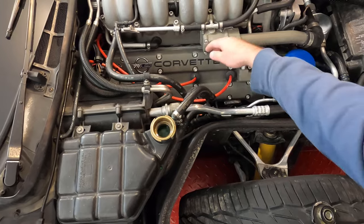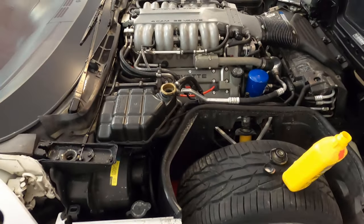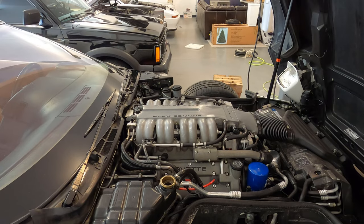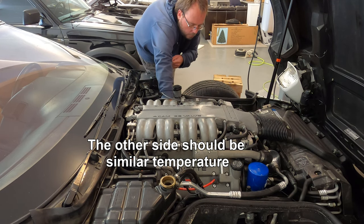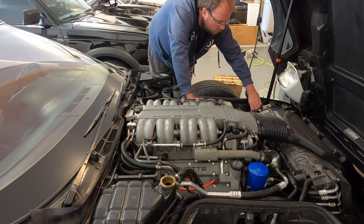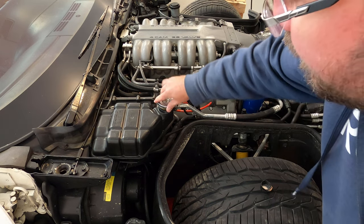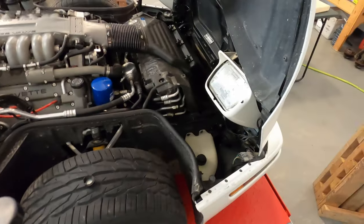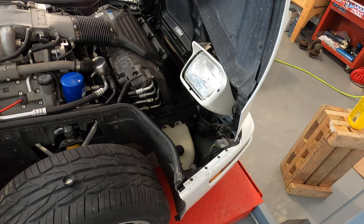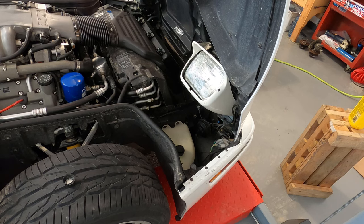And these coolant fittings here are warm. That's good. Finally, what we'll do, cap this up. The overflow is a little over half full, so as we shut this off now, that motor will draw that extra coolant that it needs as it cools into the tank, and we'll then make sure we keep our overflow topped up. But that's the coolant done.